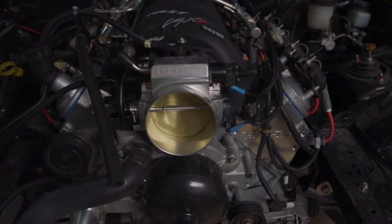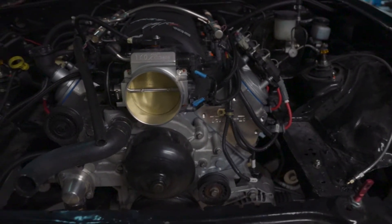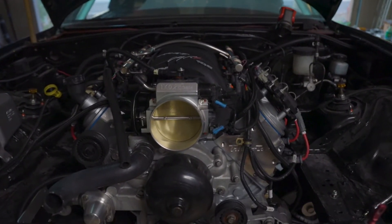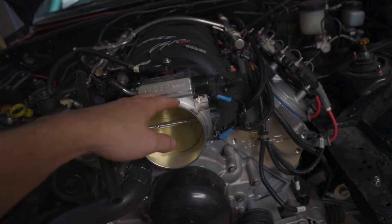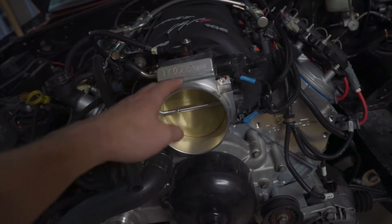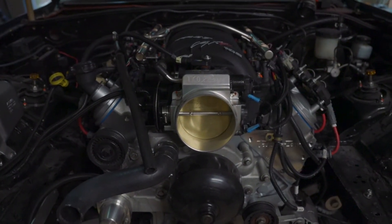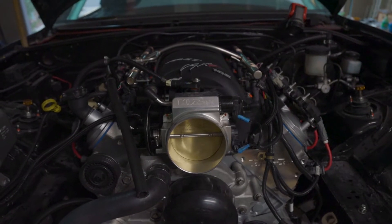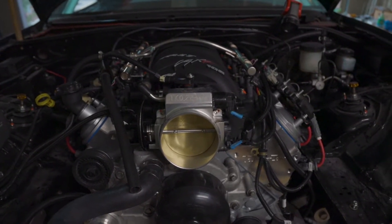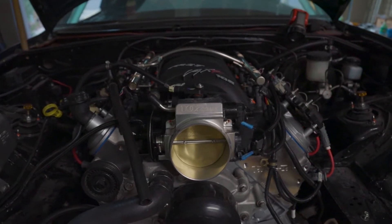This is the motor — it's not in its full final form, so there's some jankness like no spacers there, I'll explain why. But to get to the business first: you get all excited, you buy the LSXR 102, you say big horsepower, buy this 102 throttle body — big horsepower, right? And you're just gonna set it on your LS1 because that's what they say it fits. Well, not really. They made this thing to spread across a bunch of different motors and water pumps, so you have to modify a few things.